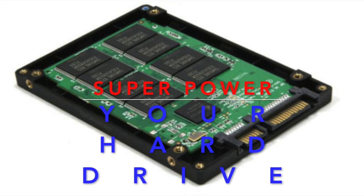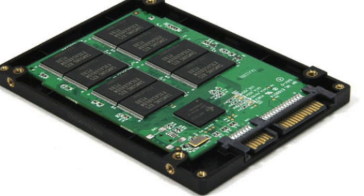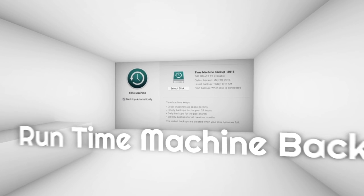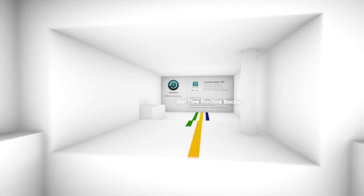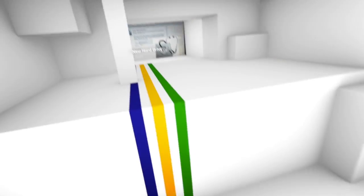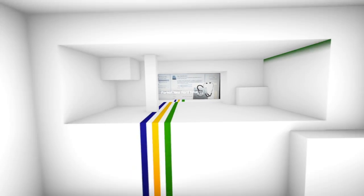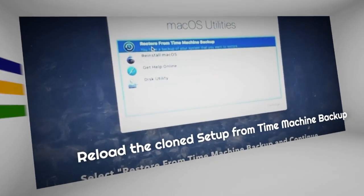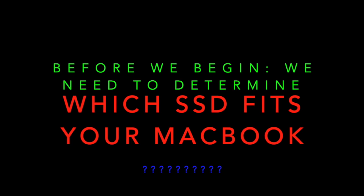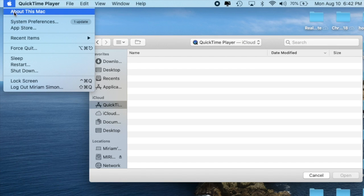In this video I'll show you how to upgrade your hard drive. I'll be posting another video about how to upgrade your memory, so be sure to subscribe and hit the notification bell. This is a step-by-step video: first we'll run a Time Machine backup, next we'll install the new SSD, then format the new drive, and finally reload the clone from the Time Machine backup. Now we need to determine compatible SSD drives — go to the Apple icon and select About This Mac.